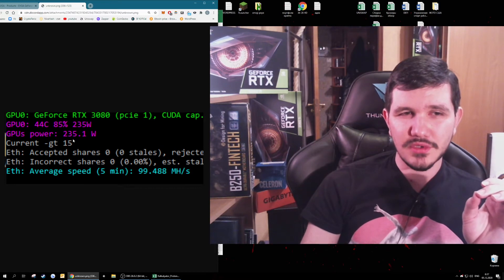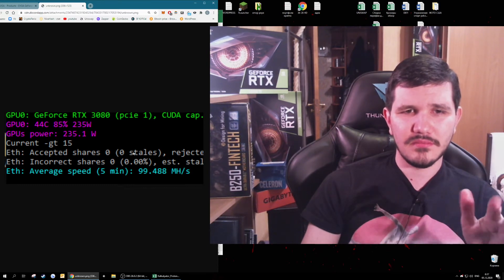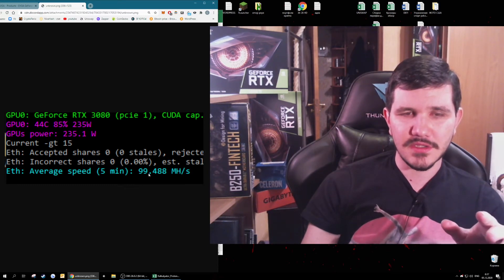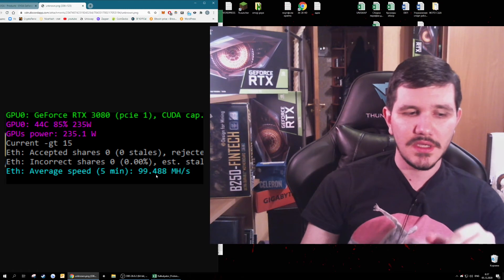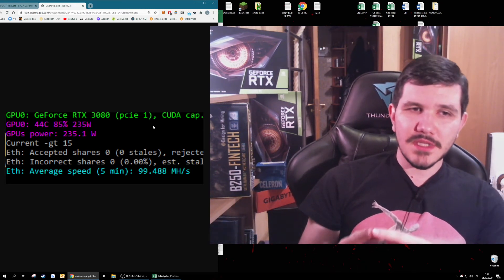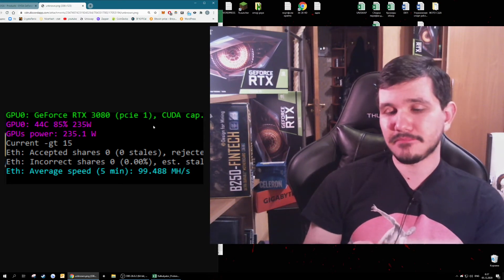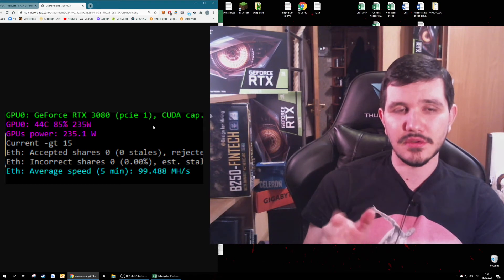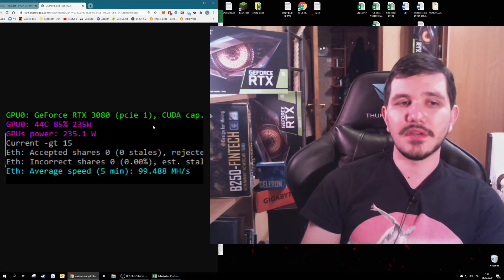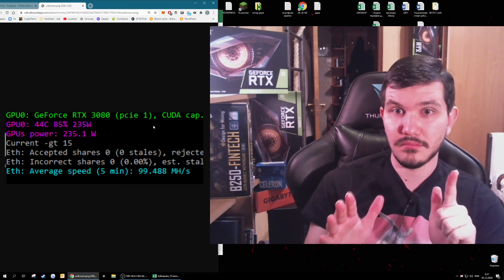Basic factory settings give you about 350 watts for mining Ethereum and about 80 megahashes. With a pretty good overclock, you may push about five extra megahashes, but it's very unstable on this specific card. Overall power consumption after downvolting is great, but noise is really an issue — it is really noisy.